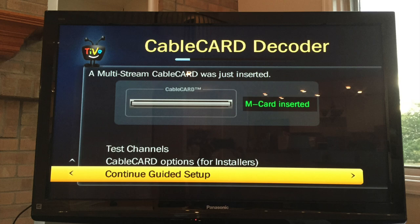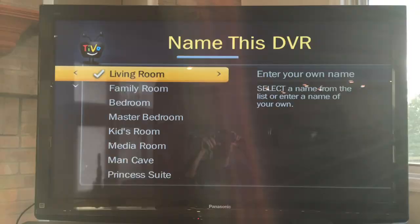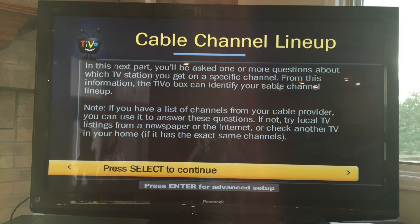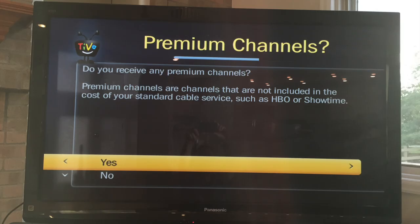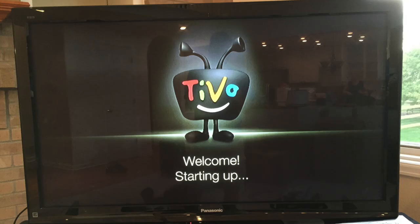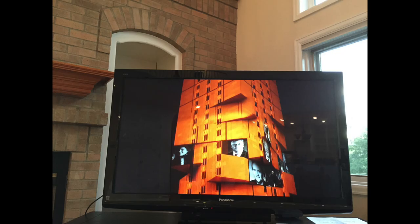The call was fairly quick for me — I just had to read off several numbers from the screen to them. Once the cable company has activated the M-Card against your account, the TiVo will automatically recognize it and switch to the next screen. From this point forward it is fairly self-explanatory. TiVo connects to the TiVo service, you pick a name for your TiVo, you choose your provider so that it knows the programming and channel lineup, and it then verifies that you can see video on a particular channel — for me it was the Home Shopping Network on channel 21. If you have subscribed to any premium channels, you tell your TiVo which ones. After completing the channel lineup, the TiVo will connect to the service again to check for updates, reboot itself, and apply any updates that it found. Once back up, I was seeing live TV.